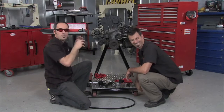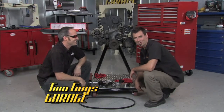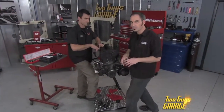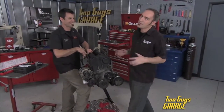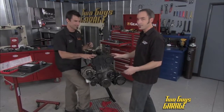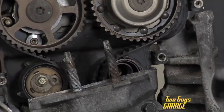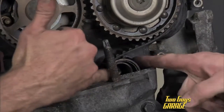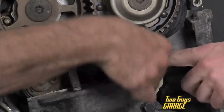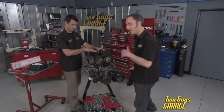I think it's time to break this thing down and start looking at all the bad things that we did to it. Welcome back. Now we kind of put this thing through a little extra abuse — once it started to get hot we drove it a little bit farther to accelerate some of the damage. It went all the way from overheat to lockup. Look at that — I haven't seen something like this in a really long time. This got so hot it smoked the belt drive for the timing drive. You can even see there are ball bearings down in there — the pulley's actually behind it, it actually melted that thing. So I have a feeling we're going to see some pretty interesting stuff.